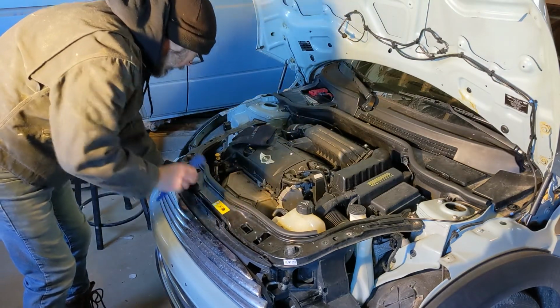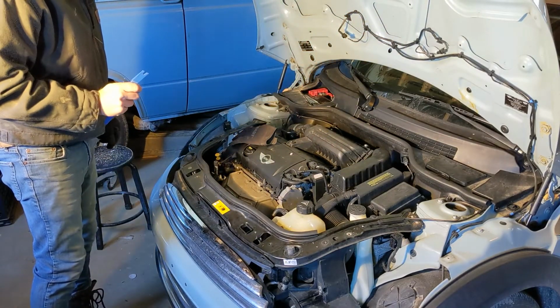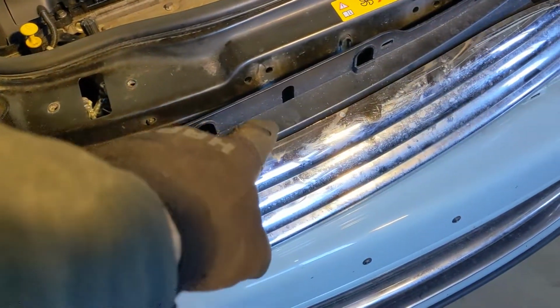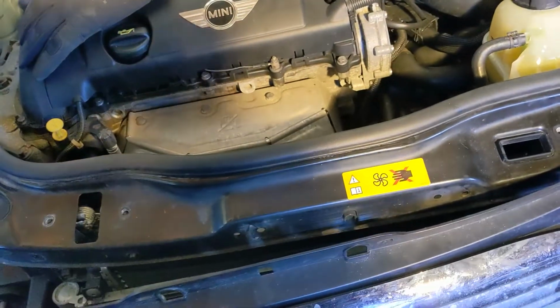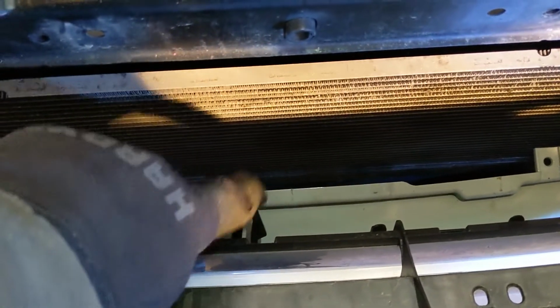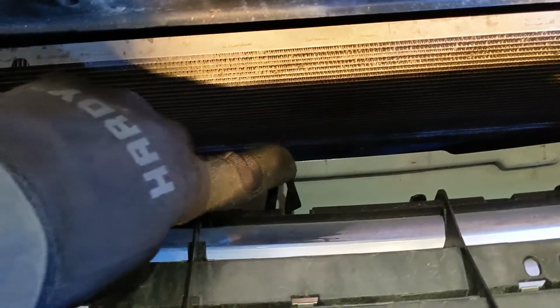All right. I believe there's another clip involved in this, so I gotta figure that out. So hang on a minute. Okay, so if you're actually following along at home and you want to get the grill off, there's these 4 clips across the front top there that we just pulled off with the trim remover tool. But then underneath here, I've got it off now, but there's these, and they just kind of hook on to a pin down there. So I just got something long and pushed on it, and boom, pops right off.